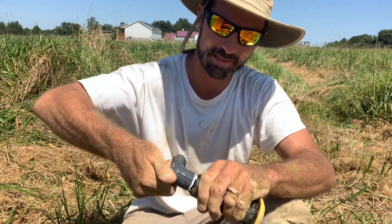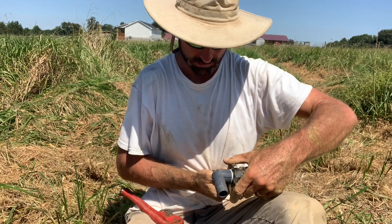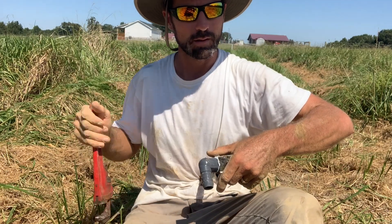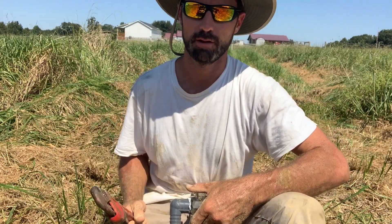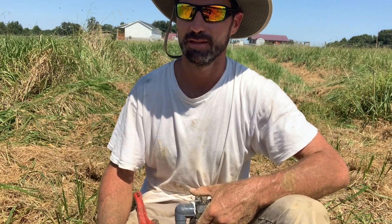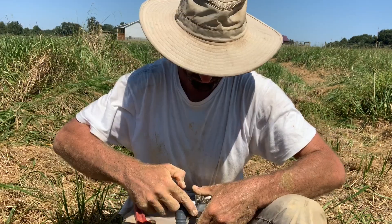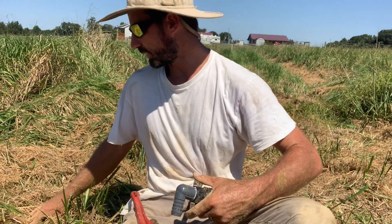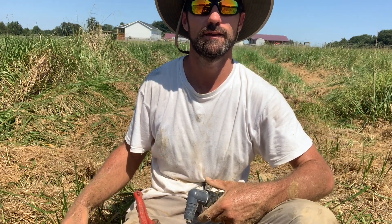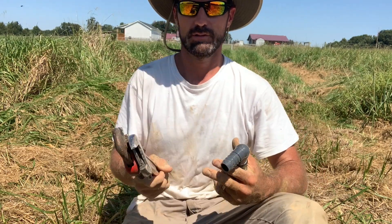I'm going to screw this to hand tight and then one to two turns maximum — with plastic fittings that's really important because it will crack. Woody bent that fitting just from over-tightening the clamp. I didn't even test it — I'm just going to replace this now along with the hose clamps, then turn it on and check. I thought it was just the clamps at first, and then I saw that and was like — yeah, that's probably the root of the problem.